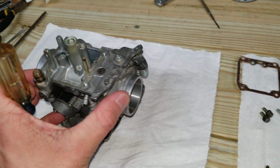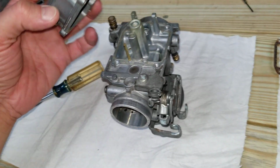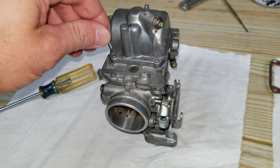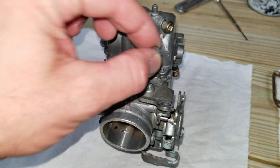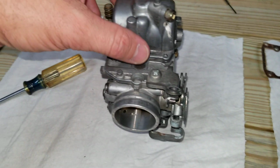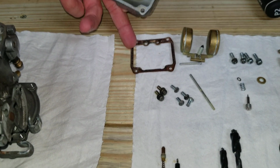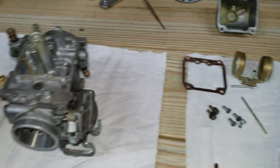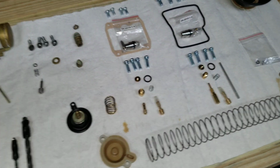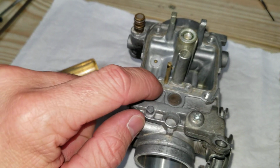So I guess we'll start with the bottom. So when you take out the screws here for the float bowl, you got 4 screws, 1 in each corner. That's these guys right there. Pull that bowl off. There is a gasket in there that I have since removed, since it's old, probably from 2000 when the thing was built. Rebuild kit, and I'll post a link to pick up this rebuild kit in the description. There's a new gasket, we'll put that in later, and that sits right here.